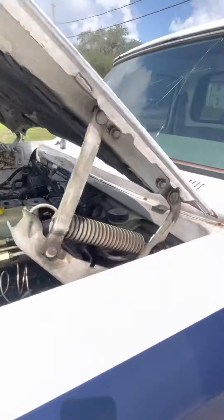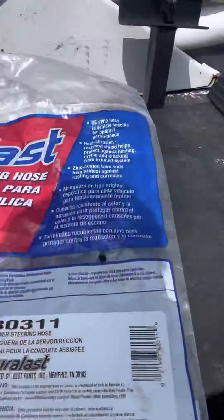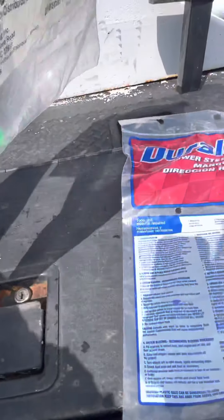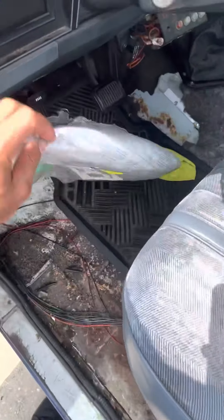It mounted right up to the actual foot peg at the back — the foot peg is higher, but I'm not a picky person. As you can see, look at the rod right there. I gotta do something to cover that hole, but check it out — much better. Here's the part number for the two hoses if you get one without hoses on your hydro boost: 8031. These are your high-pressure hoses that thread in, and then part number 3-5-2-3-4. Very easy, super simple.